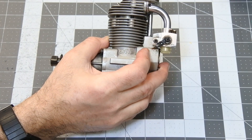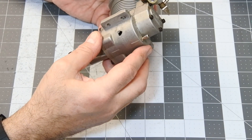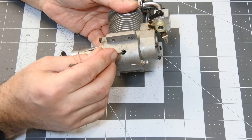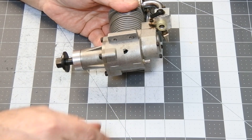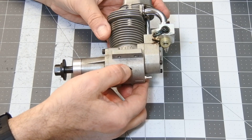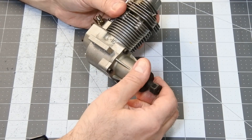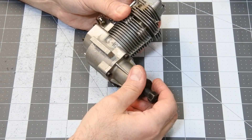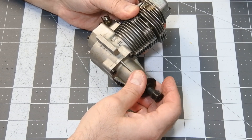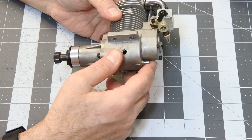Let me open the box. Here is the described hole in the crankcase. It seems the hole in the housing appeared because something fell into the gap between the connecting rod and the crankcase while the engine was running. The power input was so high that it simply punched through the thin crankcase wall.